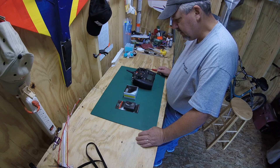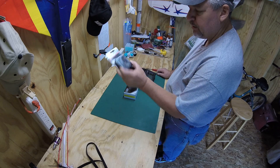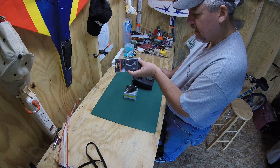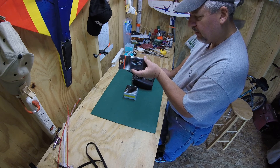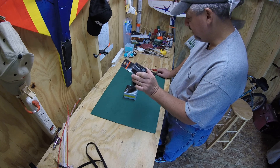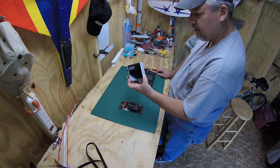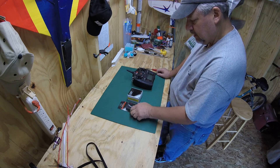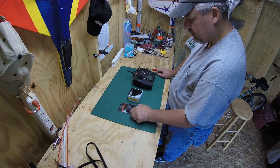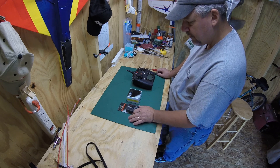Well, Spectrum just recently released a lithium-ion battery. This battery is a 2,000 milliamp hour with a 500 milliamp charge rate. It's a two-cell, 7.4 volts. And yes, the transmitter does accept it. I also purchased an international charger from Spectrum. The battery alone is about $35, the charger is about $20, so all in all, got about $50 wrapped up into this mod.